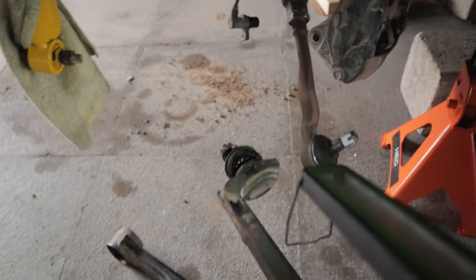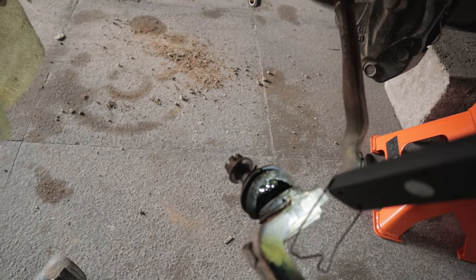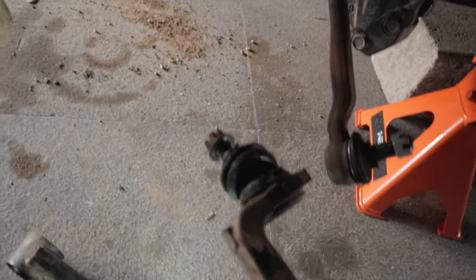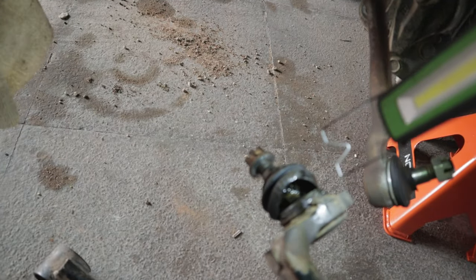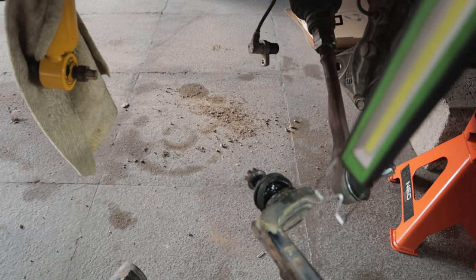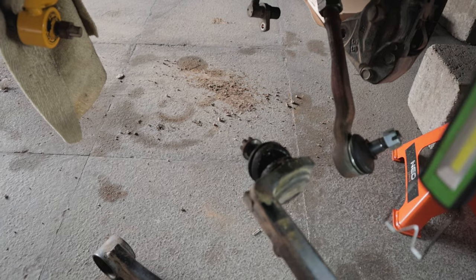The reason I did this was that at first I just wanted to replace this ball joint which had a worn boot. The ball joint is actually still fine — it is tight, so it wasn't going to fail — but the torn boot meant that dirt could get inside the ball joint, which would slowly wear it out. These ball joints are crucial to the functioning of the 90 because if they fail, the whole wheel will fall off.